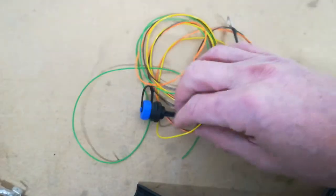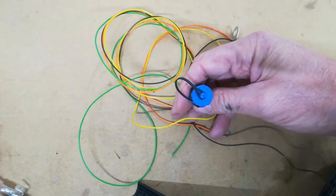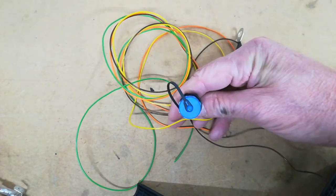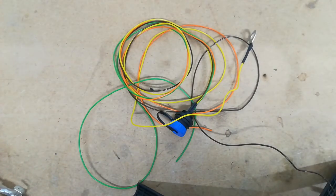So that's what I recommend: when you first get access to the IMA battery, install a little connector so you can much more easily access it next time without having to take all the covers off and all the other messing around. Just do it once and then it's done. Good luck with the charging and cycling.